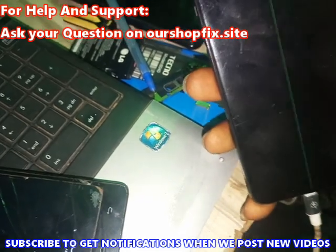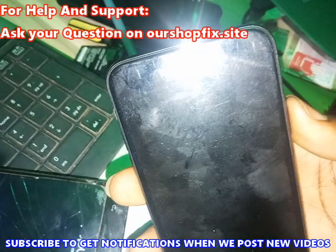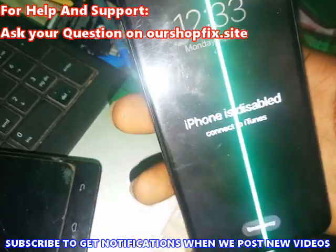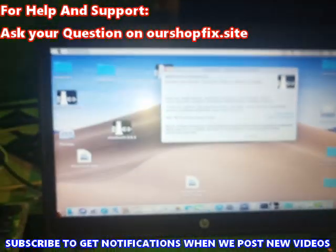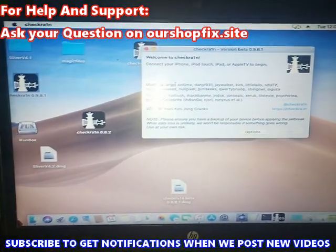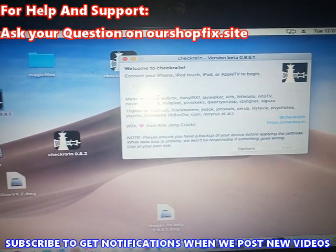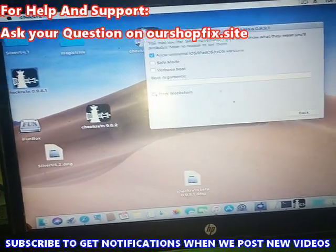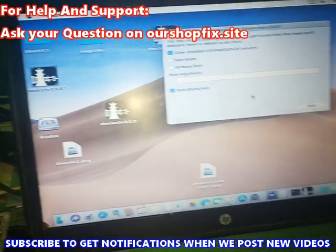That's why I decided to make this video to show you how I jailbreak the iPhone X on iPhone disabled. Whenever the phone is on, it will be waiting for you to input the passcode to verify the USB. The iPhone is running iOS 13.1.3 and I'm using checkra1n version 0.9.8.1. What I did is come to this option and select 'Allow untested iOS version'.